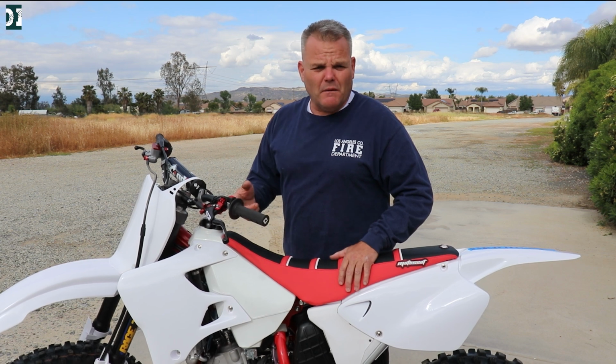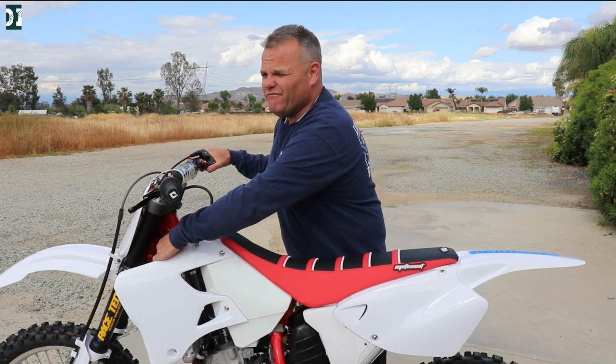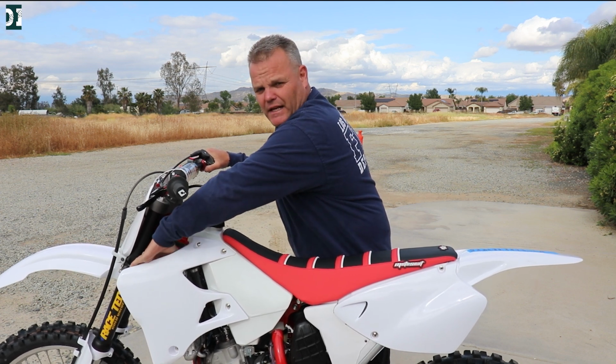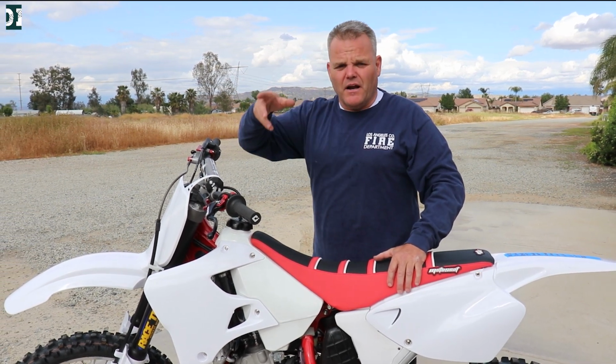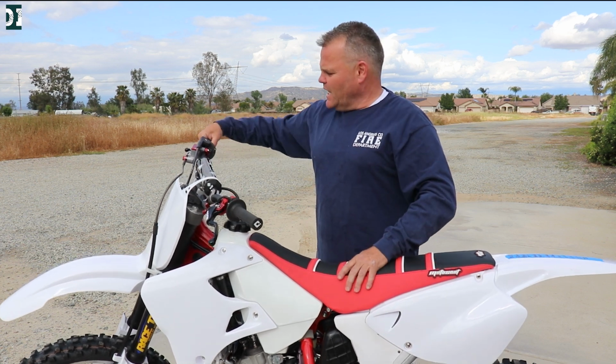So you start it up and you warm it up for about 20, 30 seconds like you normally would. Just getting the radiators warm, maybe 45 seconds, okay? Just where you can feel the radiators getting warm with your finger. And then go ride it around, just real slow. If you have an area with an empty field or a road where you can just putt around, just run through the gears, like first, second, third gears, bop, bop, bop, and just kind of give it some.